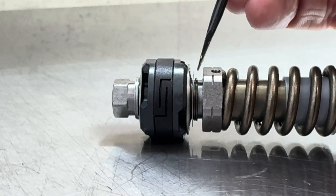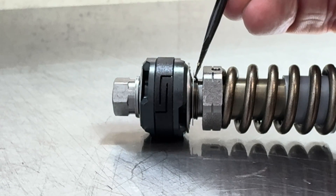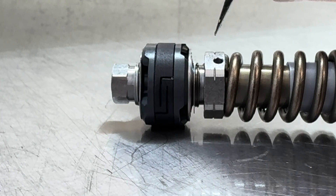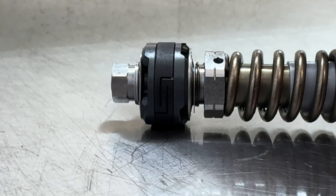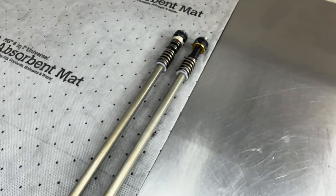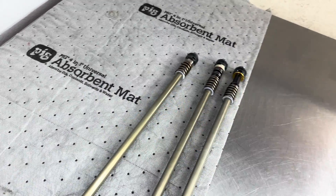What's neat about the leaf spring system is we can tune the spring rate with it. You could tune the spring rate with the coil spring as well, but you're pretty limited on tuning options. If you've ever ridden the 6500 kits — the Explorer or the Exact — you'll know they work pretty well. That just goes to show how well the WP Exact Pro cartridge system works and how well it responds to modifications, regardless of whether you want the older shim spring style, the JBI leaf spring style, or the cone valve style mid-valve. I just wanted to show you the three different styles of mid-valves inside these WP Exact Pro cartridges and what's available.